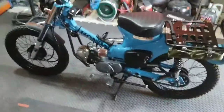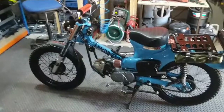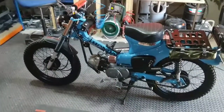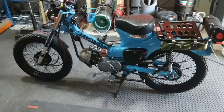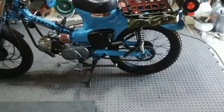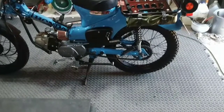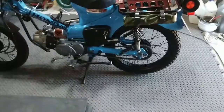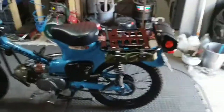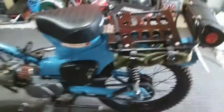The electrics were pretty much the biggest single job on any bike rebuild, certainly the ones I've done, so the electrics are all in and working well. I had a bit of a problem with the chain — as you can see it's a little bit loose. It is rideable — I rode it yesterday — but it's on full tightness. I need to have a link taken out and I'm currently waiting for a link extractor which I bought on eBay. When that comes through I'll take a link out and tension the chain up properly; it's just one link too big.